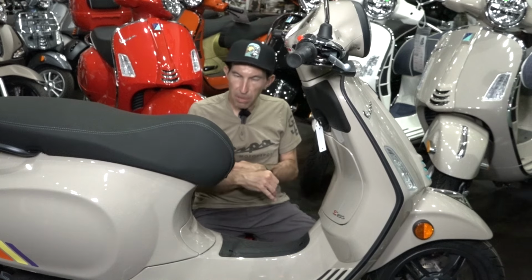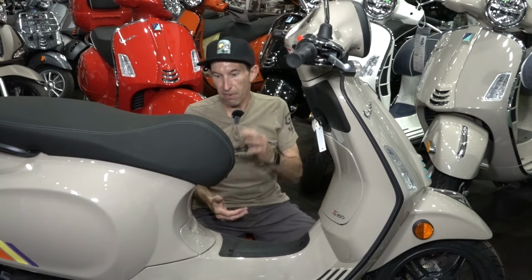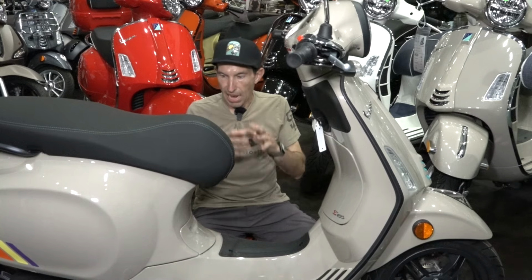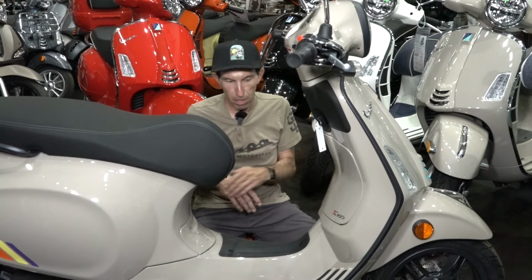Another thing I get asked about: I just need to buy a spark plug. I have people walk in here all the time saying they want to buy a spark plug. I'm like, why do you want to buy a spark plug? They have a very nice NGK spark plug that lasts the service length of the scooter, 6,000 miles. So technically it'll last about 12,000 miles with no issues. So not much need. These things have fuel injection. They're not going to foul out the spark plugs. They generally keep the plug really clean, and with a high quality plug, it's not something you need to mess with. Like most modern cars, I think the plugs are rated for 100,000 miles.